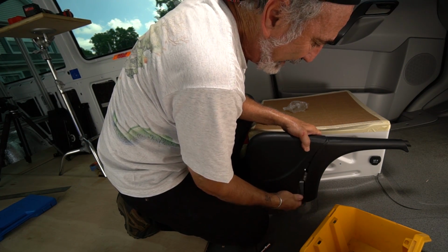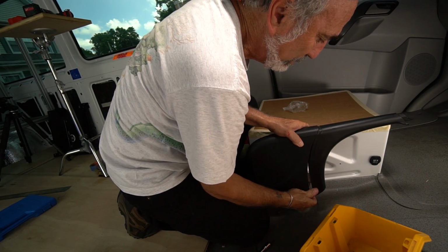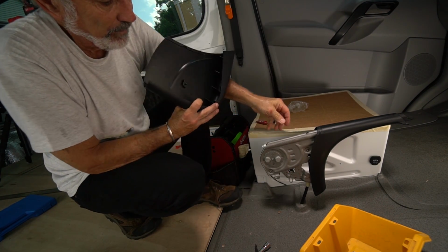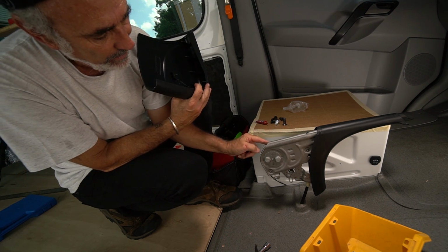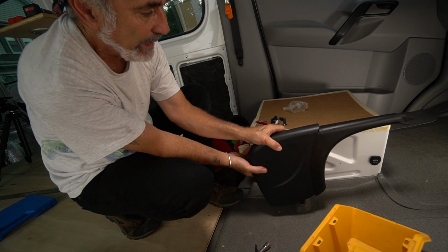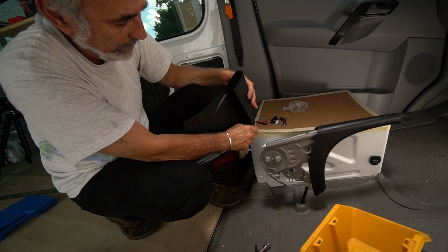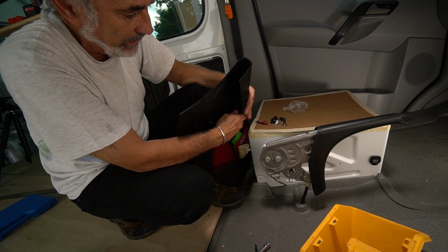You may have to shave out these little pieces here. Yeah, I bet you do. Nobody talks about that. There's these little support pieces. Now that you've lowered this, the support piece that would normally just rest here, since you lowered it on the original van bracket, you got to break this one away so that you can get this low enough to click in. This first one or the last one in the back on that far side, you have to take that out because now it's hitting.